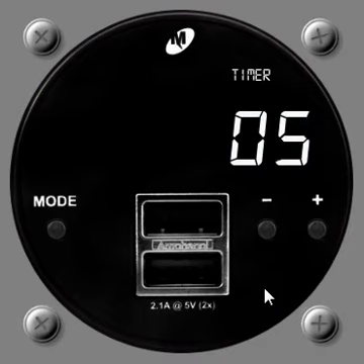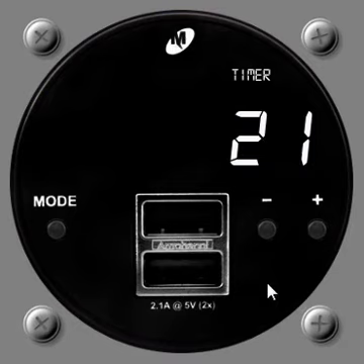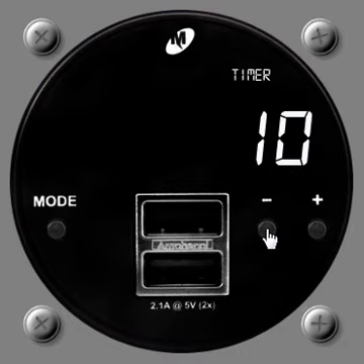It's very similar to the other clocks, and when it gets down to zero you'll get the audible tone again, because it's set on as default. You can turn it off, it starts to flash and then continues counting up. You acknowledge the audible tone by pushing any of the three buttons, then it continues counting up. Push the plus button to stop, and push the minus button to reset it back to the previous time. If you want to do the same time again, just start the sequence again, or enter setup mode with the mode button to set a different time.